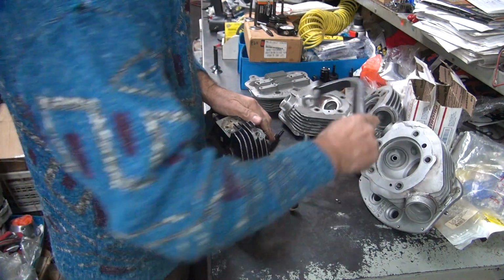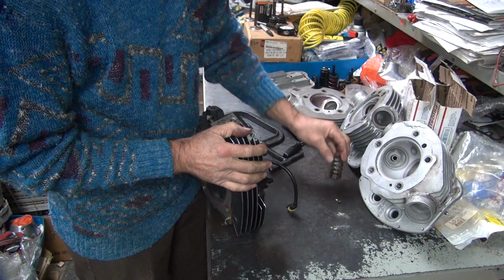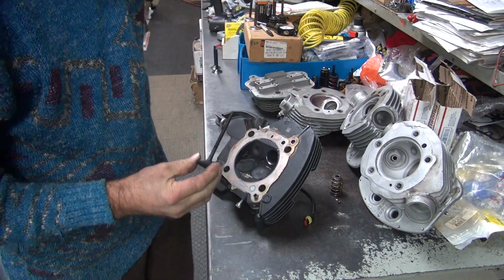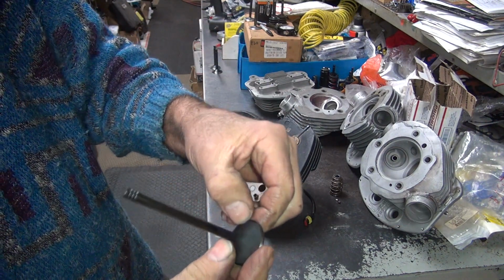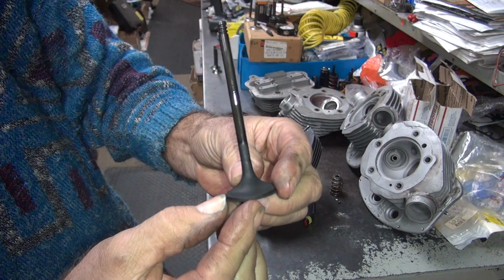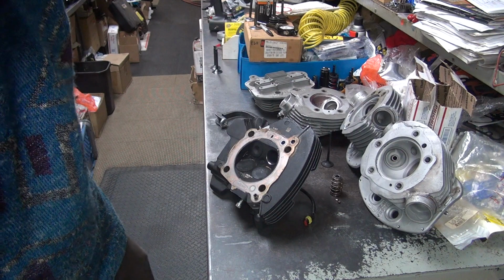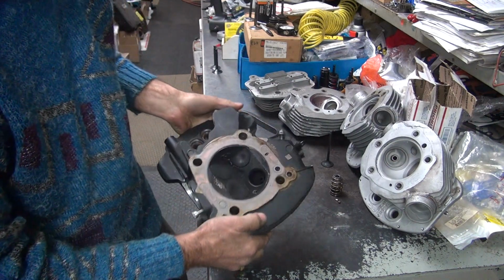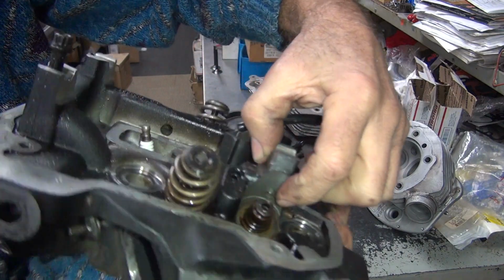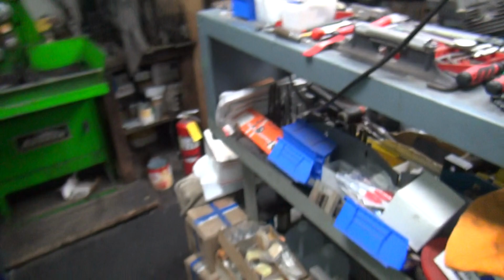Okay, one modified spring compressor. One valve spring out of the way. Okay, now we get to look at the valve. See what they did to it. They didn't back cut it. If you back cut that, you'll gain some power. They didn't back cut it. Rarely does anybody back cut stuff. Seems to be a lost art for some reason. Okay. So now you can see the hole where the spring used to be there. So now I can do what I need to do. Cut, cut, cut.